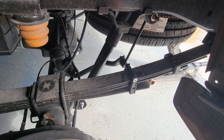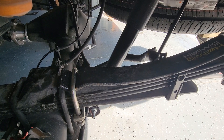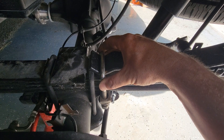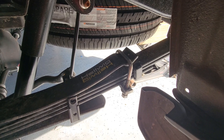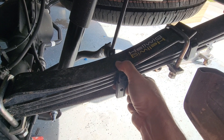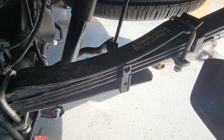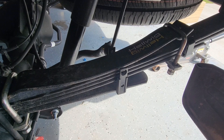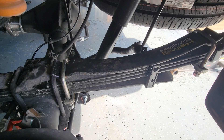This should give me a little bit more load carrying support. I noticed the other day I needed a little bit more on this truck, so I'm going ahead and putting these on. Now that I've got everything loosely bolted up, you can see I've got the front one — I still need to tighten it all the way. The rear one is barely going to clear this bracket, this retainer on the leaf spring pack back here, but it looks like it's going to work. It's going to be close, but it should work. I don't think we're going to be able to put the retainer bar back in because with this additional spring, the pack is just too thick. But I also don't think it's necessary. This vertical piece is still going to prevent the leaves from getting out of whack, and with this top plate clamped front and rear, it's not going to let the leaf pack come apart either.